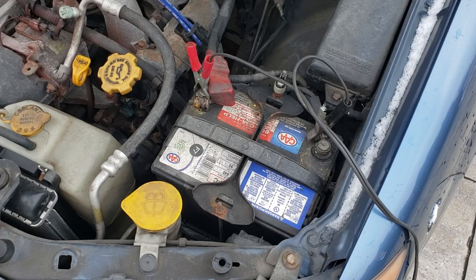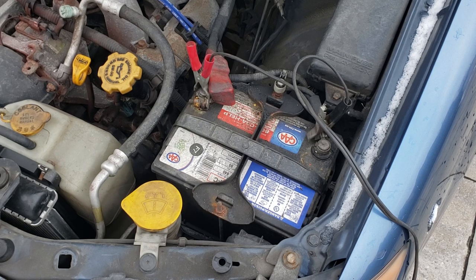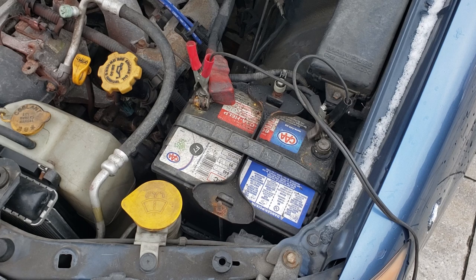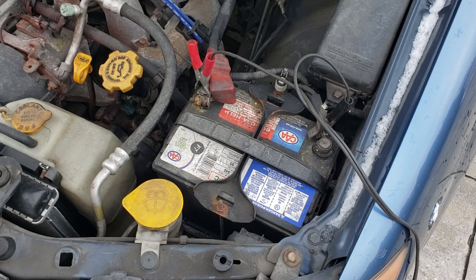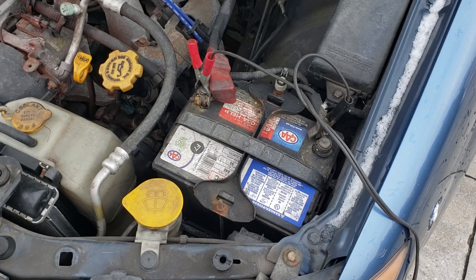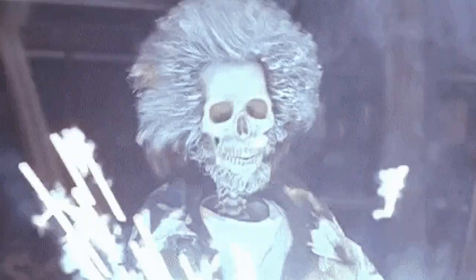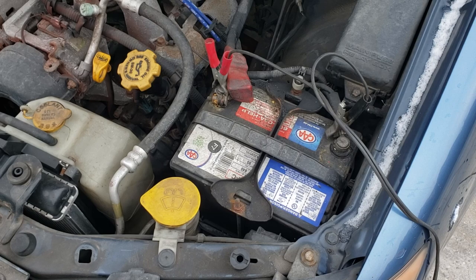With the charger hooked up we're letting the battery charge. We dropped down to 11.3 volts in that short period, which shows how critical it is that you pull over — it doesn't take much to drain your battery and possibly destroy it if it gets too low. If you see those lights, get off to the side of the road and get a tow truck, or do what I'm doing and just change the alternator. Make sure you disconnect your negative battery cable — just grab a 10mm — whenever working on any electrical system to avoid headaches.